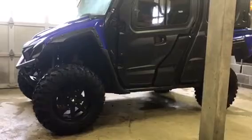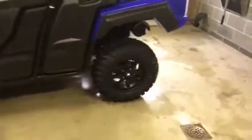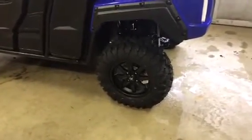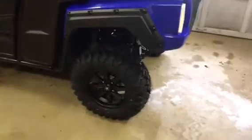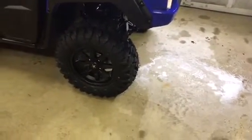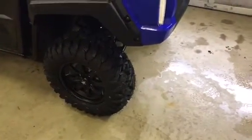Okay guys, I got the wheels and tires on. It definitely gave her a new look, definitely made it look a little meaner, and definitely made it sit higher. I measured the width on the machine — front and rear with the stock wheels and tires it was right at dead on 60 inches. With the new wheels and tires from Yamaha, the MSA wheels and the EFX Motoclaw 27 by 10s, it's now about 63 inches wide.